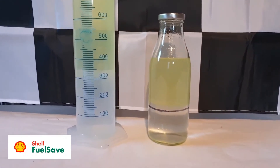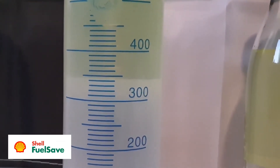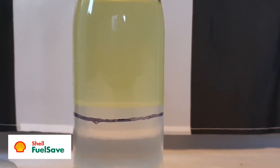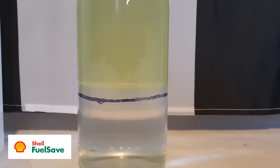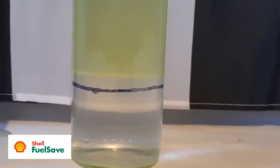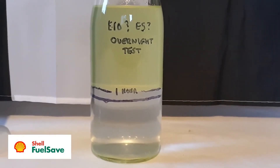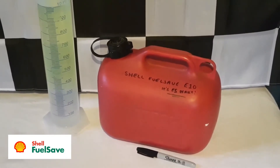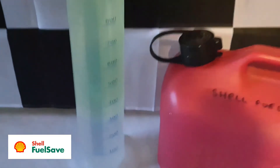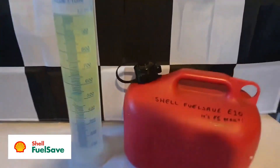Coming back an hour later, the clarity of the petrol is mostly unchanged — maybe slightly clearer, but it's hard to tell on the plastic cylinder as it's opaque. The line is still at 340, which is surprising because 335 millilitres is E5 and this is supposed to be E10 petrol. I'm going to mark a line on the glass bottle at the current level — the initial water line — and then after one hour of mixing, do an overnight test to see if the line raises further, which would mean this cloudy murky petrol will translate to more water and ethanol mix. Although it's unsurprising that E10 petrol contains ethanol, what is surprising is that this is still reading as E5 — at 335 millilitres — when E10 would be 370 millilitres. However, fuel suppliers are allowed to sell E5 stock until December.